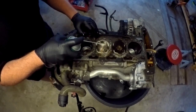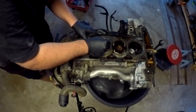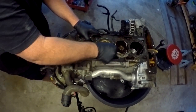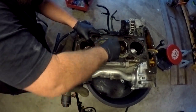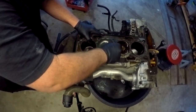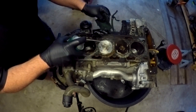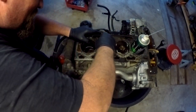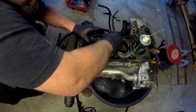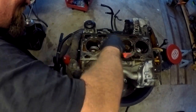What I'm really looking for is whether the pistons have actually been severely damaged when they came up and hit the valves. Next I'm using a green Scotch-Brite pad to give it a good rub and look for any of that damage. This needs to be done to each piston, but I just wanted to show you in real time how quickly it is to clean them up and make sure they're in good enough condition to reuse. It just takes a few minutes using heaps of WD-40 — there are a few tough spots of burnt carbon that just need a bit more work.